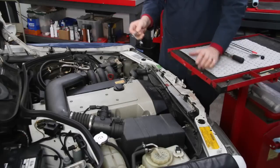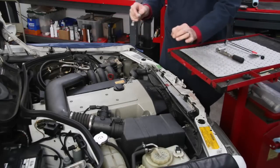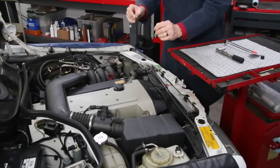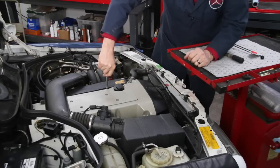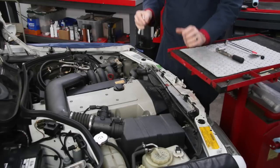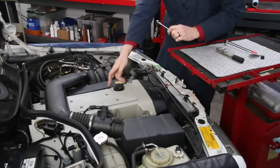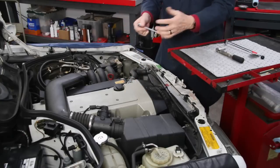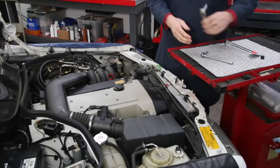This is what I used when I torqued this, because I was having problems with my click-stop torque wrench and didn't feel it was giving me a good accurate feel. With this small wrench you can feel the bolts tighten down, feel them start to bottom out, and then just a little tweak of the wrist is enough. You're not putting excessive torque on them, because if you do you'll strip those aluminum threads out and then you have a big problem.